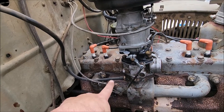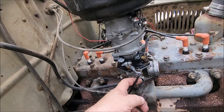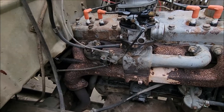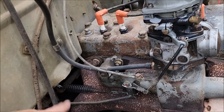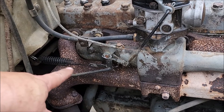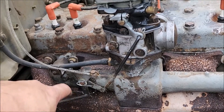We did the return springs a little differently. It had it hooked up here and then a spring and another spring — had two springs hooked together all the way back. I'm not quite done with it; I got to get some little tiny washers and some different spring clips — I want to replace all these cotter keys. I got a set of springs off of these things you see on a small block Chevy, with a little tab coming off so that when it rotates it will always stay at the same angle and keeps it away from the exhaust manifold so it won't rub. I just gotta replace this cotter key and find a little spring tab.